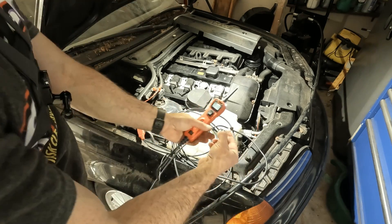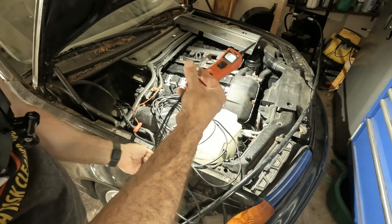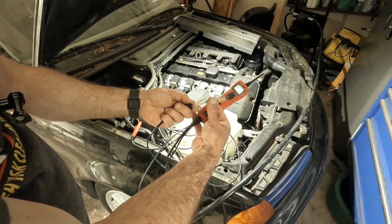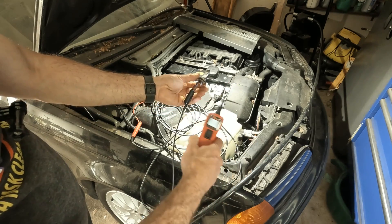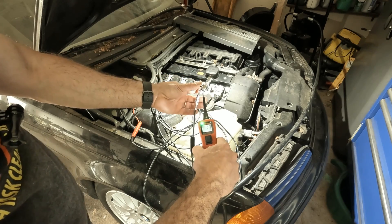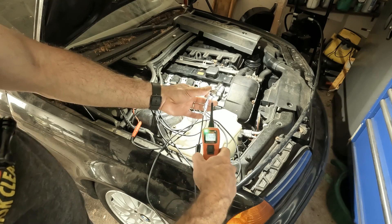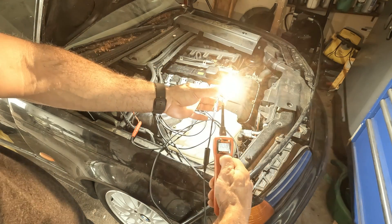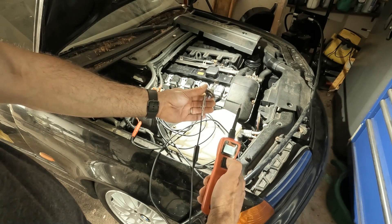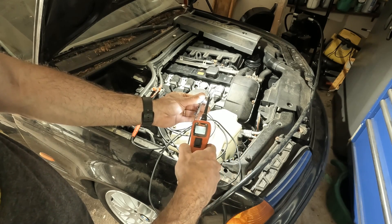We're going to do a fun little test here. Here's my bulb. What's great about a power probe is there's a ground attached right to it, so I can put a ground on one end. I'm just going to touch the other side — you see it's grounding through the circuit but there's no power. And once I apply power, we have light. This is a great way to test your bulb, just in case this is a bulb issue.